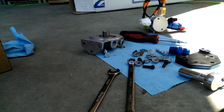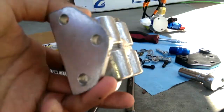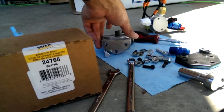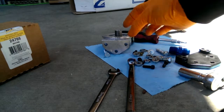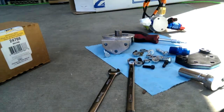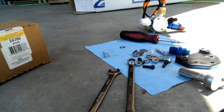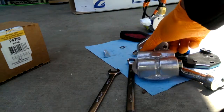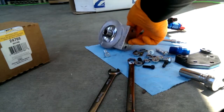It worked out for the best — I was able to hop online and order this. This is an oil filter mount by Wix, part number 24766. What's better about it is it's higher up. The issues I was having clearing the inner roll bar — they're gone. Because this is a little bit higher and the points where the inlets and outlets are, they're narrower, so you get better, easier clearance.